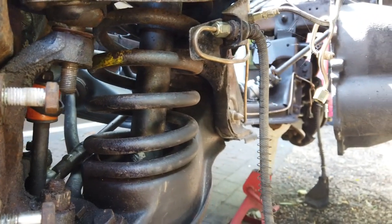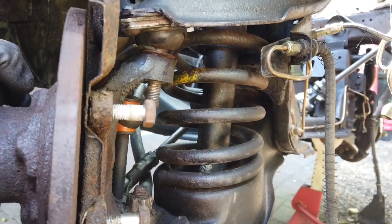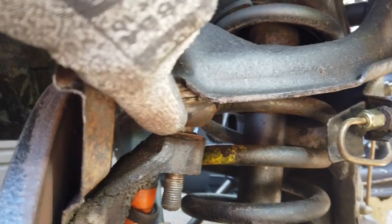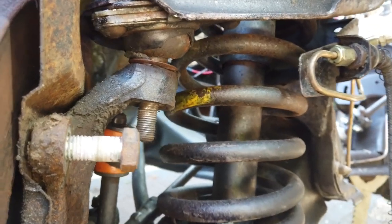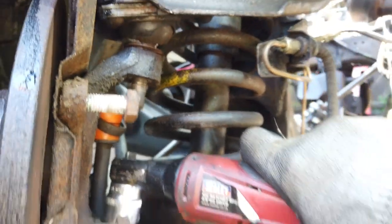Back on after doing the brake caliper rust-up. We've got the brake caliper kit to fit, but also upper and lower ball joints have arrived - these are tired. So we're going to take these off, split pins out, and then the retaining nut for the ball joint off. One for the bottom to go loosened and then finish off with a ratchet.